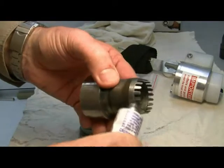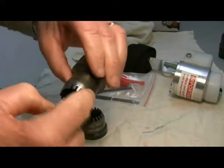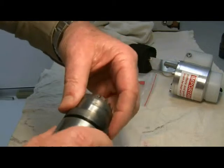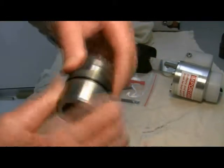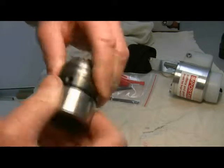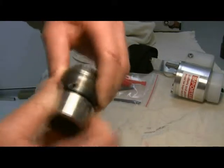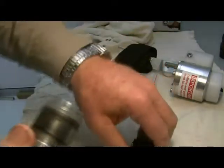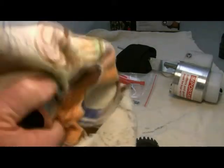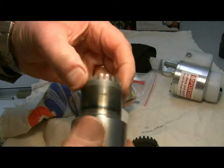What we can do is apply a little bit of ordinary valve grinding paste, such as you might have used in your old car in the good old days. Just smooth that around and fit it inside. Work it backwards and forwards for a minute or so. This can hone or clean up the face a little bit and make sure that any small ridges that have happened as a result of grit mixing with the oil — causing a grinding paste effect — are smoothed off. When you clean that paste off, you can see where the cutters are touching and where they're not. That should be reasonably even all the way around.